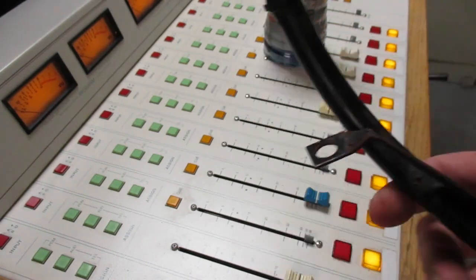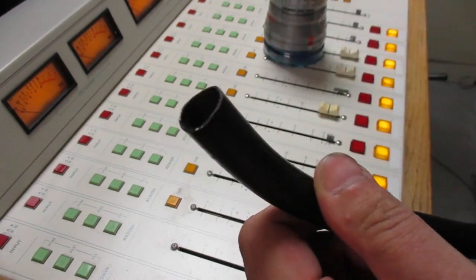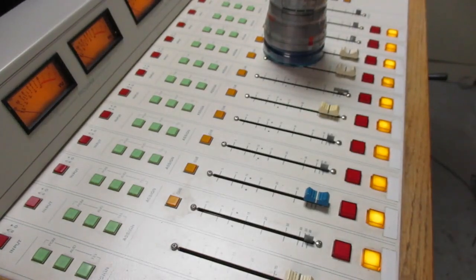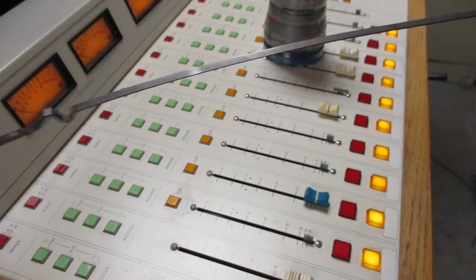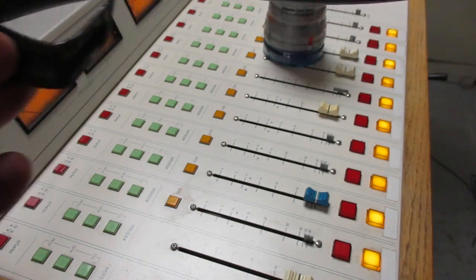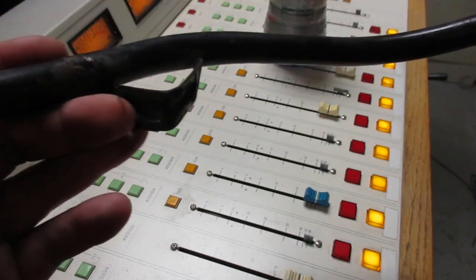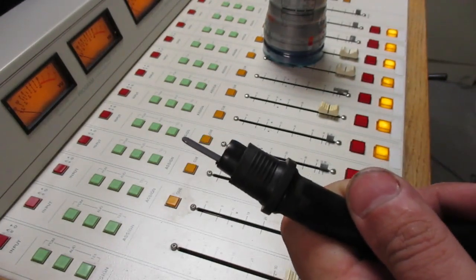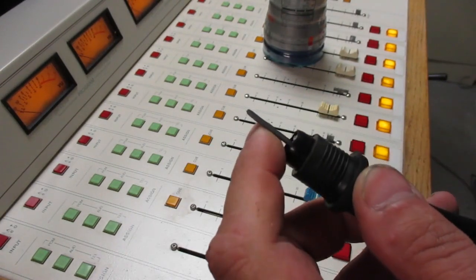So I kept my little retainer hickey. Now I cut the dipstick tube a little short. See, this is all the longer it is now. And I cut the dipstick short. It's a little bit longer than that. What we need to do is make the dipstick come out the end of here right on about 7/8 of an inch, or thereabout. It doesn't have to be precise, but about that much.